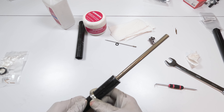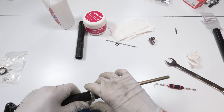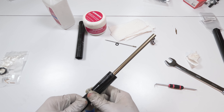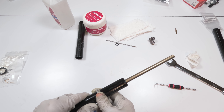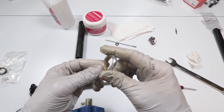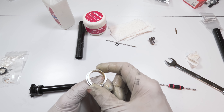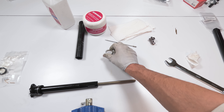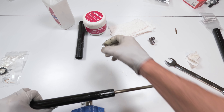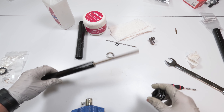We'll take out the bushing. A good way to know if you need a new bushing is if you have it on the post and it wiggles or moves sideways. This one is actually in outstanding condition. I don't remember the last time I changed it — maybe three years ago. Basically, if there's wiggle or a lot of play, it definitely needs to be changed. If there's any kind of wear on it, swap it — change it out. If it has wiggle while on the post, absolutely change it out. So then we have the collar.